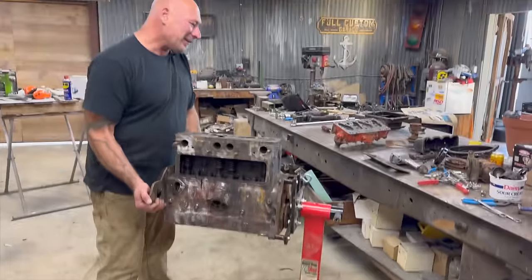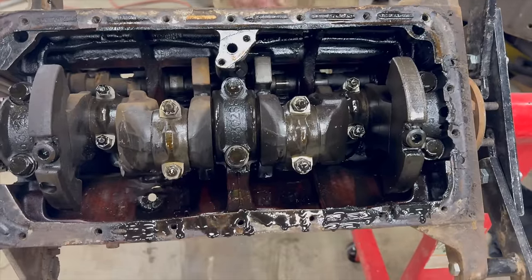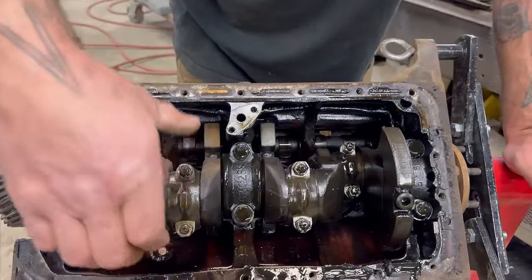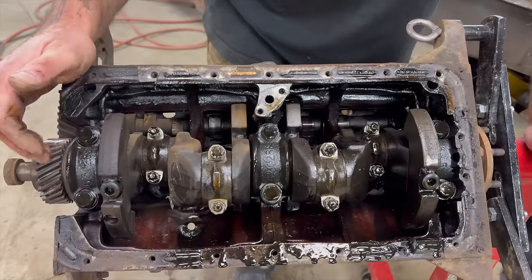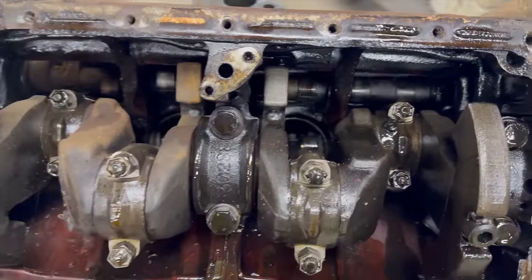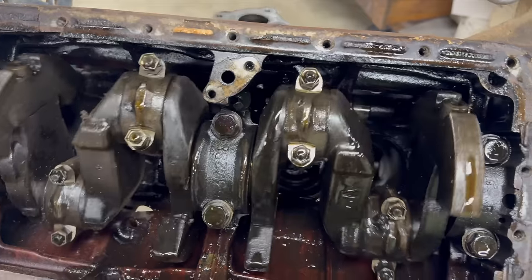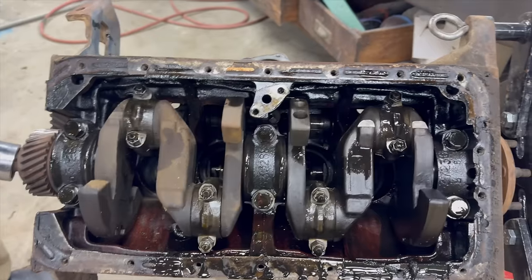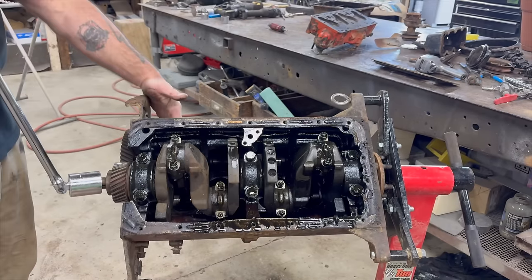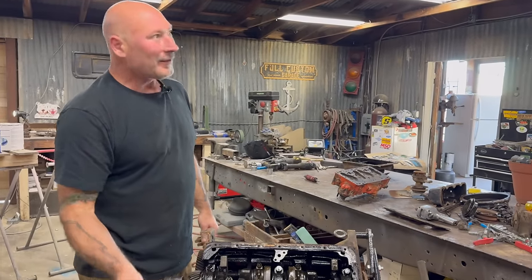Here it is. This is what happens on the underside. The bottom end is what it's called — so that's the top end, and the bottom end is all of these little — they're like holders that hold bearings. It's called the connecting rod. It's kind of like a bone. The connecting rod connects the piston to the crankshaft. So these things are pushing and pulling on the pistons. And all the while it's turning an oil pump which pressurizes the oil through all these bearings. It's turning a water pump, making a fuel pump go tick tick tick tick, moving valves, turning the clutch, which turns the transmission, which turns the driveline into the axles, into the tires — and then you drive.